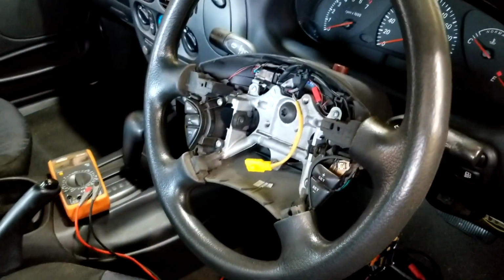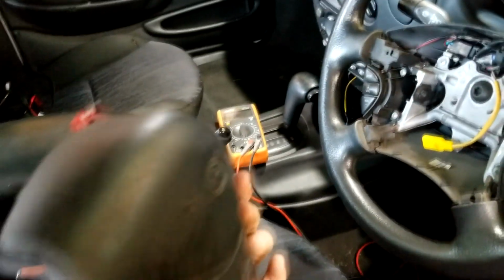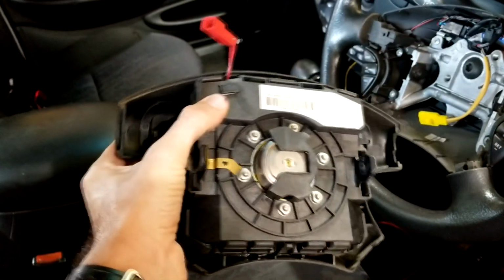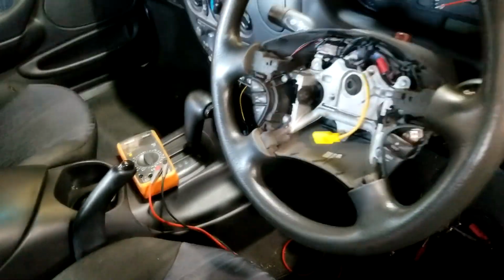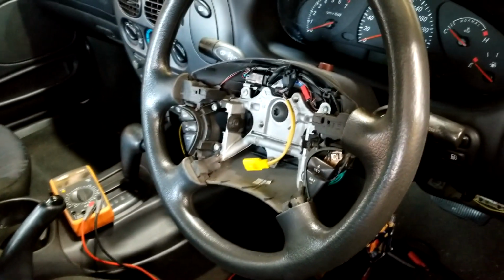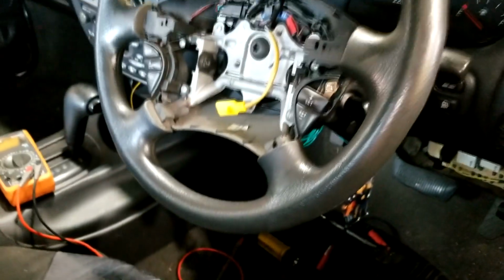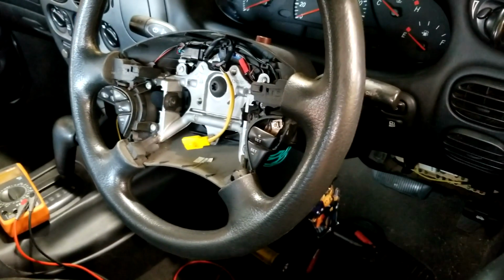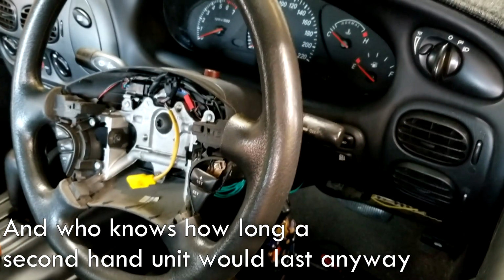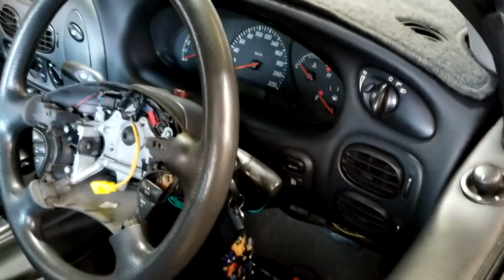And it's a new day, so first order of business for me has been getting this steering wheel center out, because the horn buttons in it have, the insulation there is broken down so the horn would stick on. I bypassed it sort of a little while earlier, but I sort of wanted to get in here so I could actually trace the wires for the horn switch back down under the steering column so I could properly bypass it, because I'm too cheap to buy a new steering wheel center and I don't really feel like going anywhere anyway at the moment. And also, I want the cruise control. I don't have any cruise control.